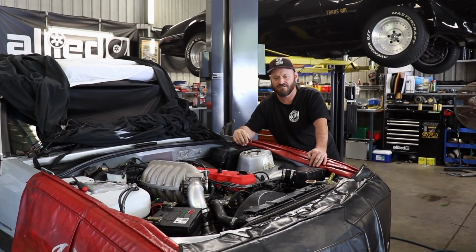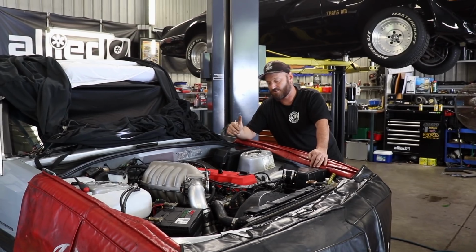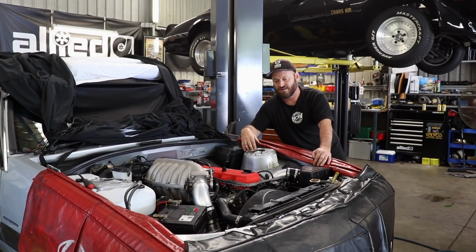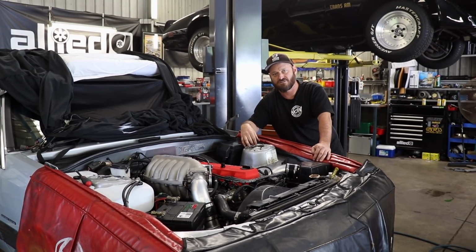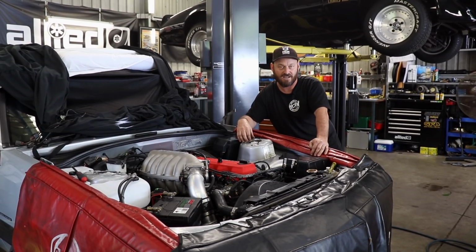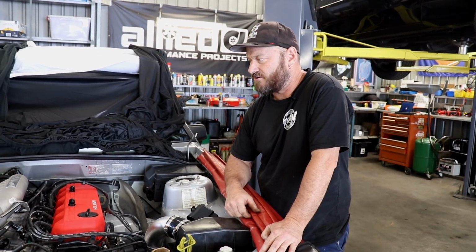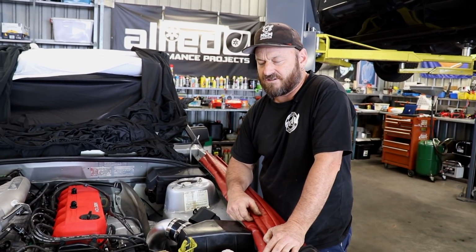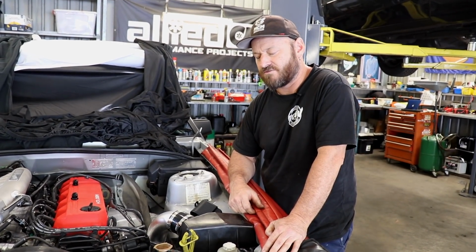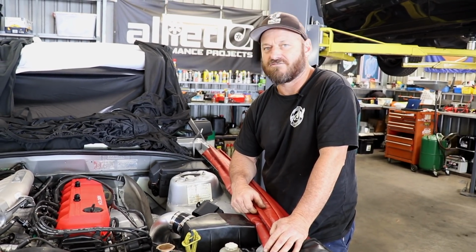Don't get overexcited. This is a crucial time. If you do it right and there is a problem, you just shut it down, fix the problem, and continue on. Don't go free revving it to eleven because you're excited about getting your engine started for the first time in a couple of years. Use your head. Probably something that should be mentioned with cooling systems, unless you've got like a 1965 Nova with a 283 in it: most modern cooling systems, as in the last 40 years, are not as easy to fill as people think.